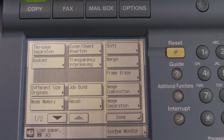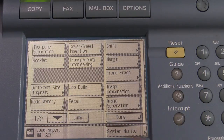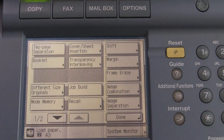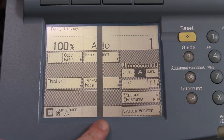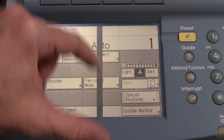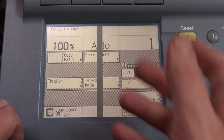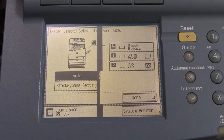Special features — it does all the two-sided copying. It's warming up because we went into copy mode so it has to heat up the fuser. It supports mailbox and scan to mailbox. But then there's this issue — a black line appeared and then it just faded in. Maybe this is why it was tossed out. There's some tearing and fading. Maybe it's a driver problem or power supply problem — kind of a capacitor-charge sort of thing. But that's not going to stop us using it; the touch screen still works fine.